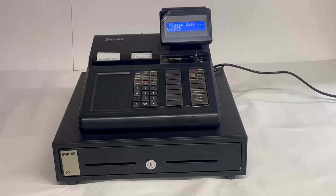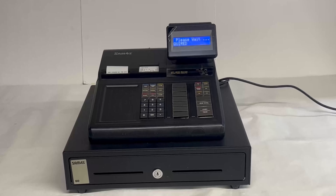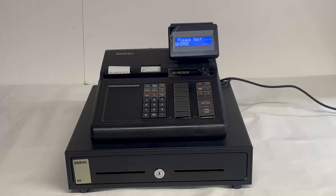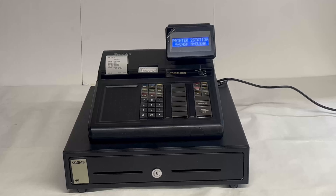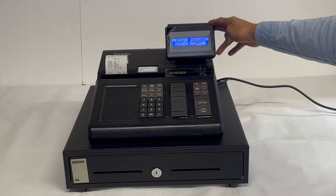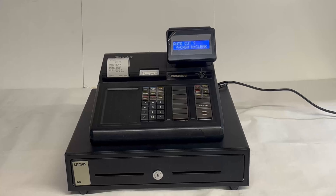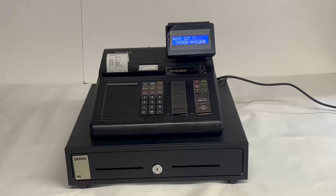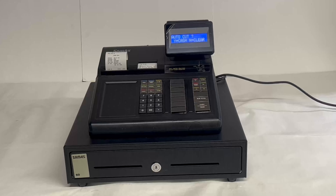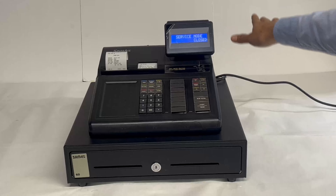You're going to wait a little longer. When you reach the printer station prompt — yes for cash, no for clear — we're going to hit yes, so hit cash. Then it will ask about auto cut. This is very important: this register doesn't have an auto cut mechanism, so you're going to hit no, which is clear. Hit clear and you're done.